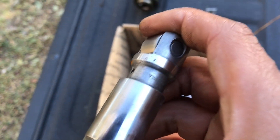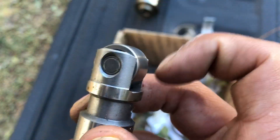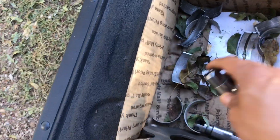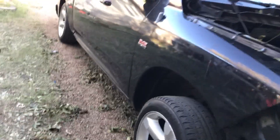I feel like they're good lifters, but due to the fact they weren't getting any oil it went bad. I got four new ones and the rest that were fine we're not replacing. These are the non-MDS lifters — they say they're hellcat lifters, I'm not exactly sure — but as long as they're OEM they'll be good. Just make sure you get the non-MDS, and if you're planning on doing a cam, check your bearings, because that's what can cause low oil pressure.